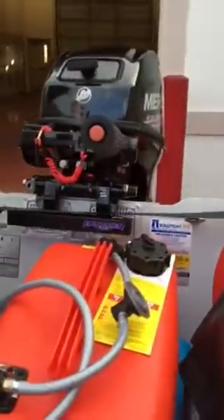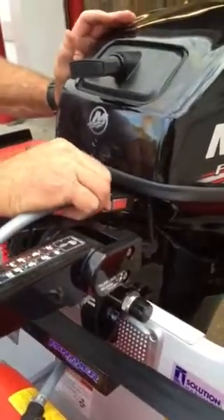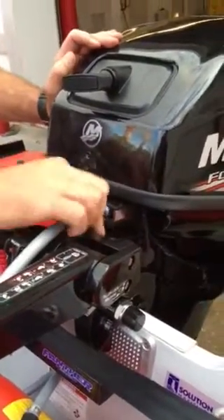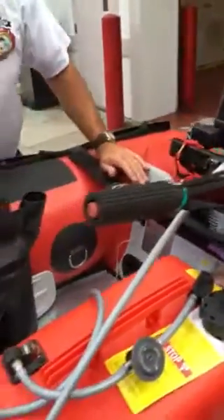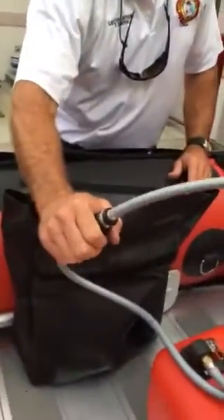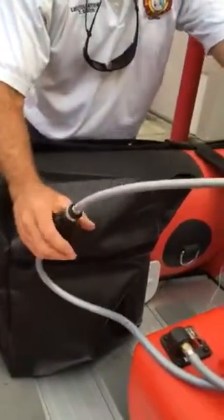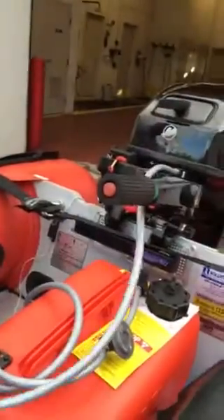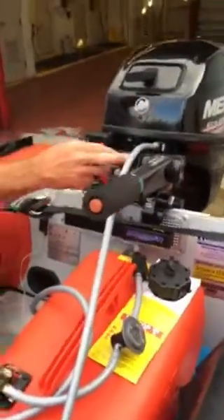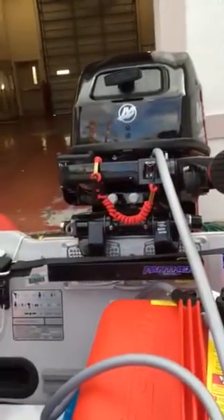To start this, we need to connect the gas to the motor — it's just a quick clip, a plug-and-play type of deal. You hear the snap and you know that you're good to go. To assist in cranking this, I want to hit my primer ball a couple of times. I feel now that it's good and firm — I've pressurized this fuel line, so I know that I'm good to go. We've got a kill switch here and we are in the run position, so the motor is ready to crank.